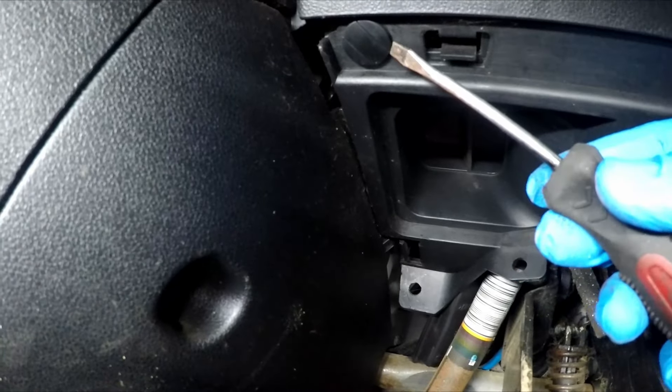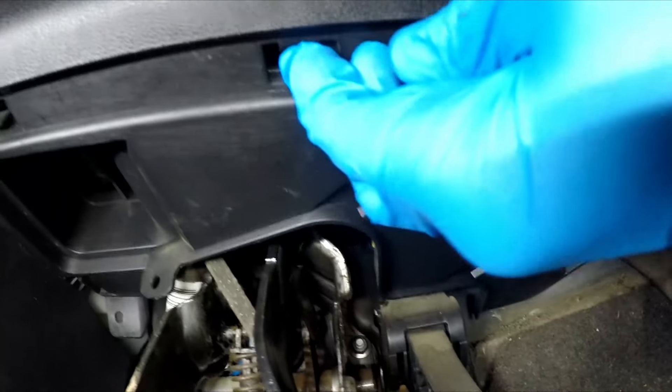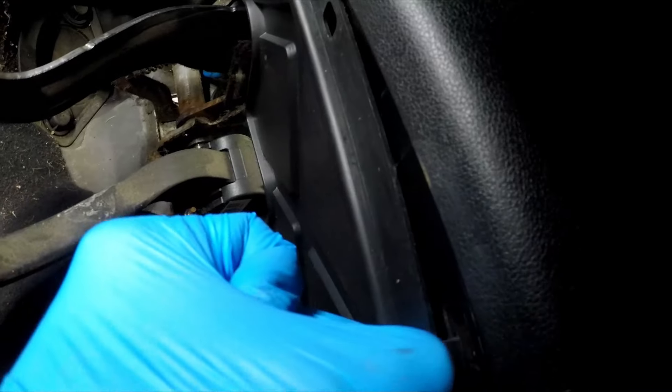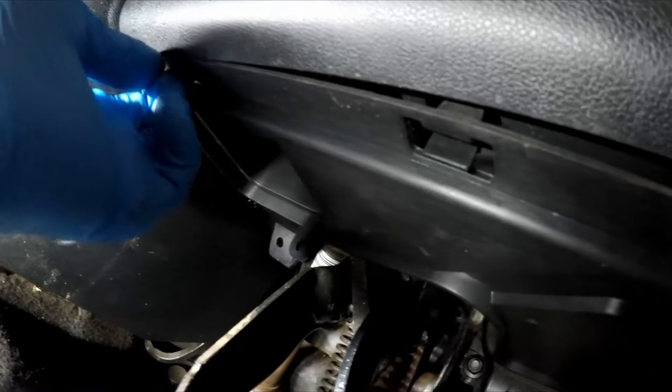There are a few of those on the front edge. Just flick out that center piece and she's out. Then all the remaining clips here — these are just a tag to put your thumb against. Squeeze and it pops down. Pull the tab towards you and pull down. The cover comes forwards.